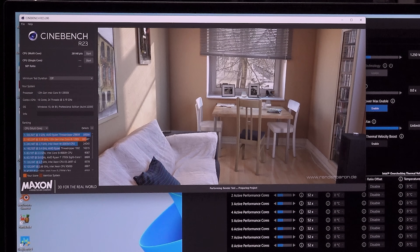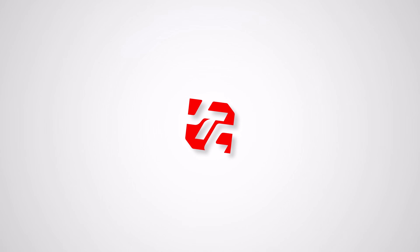Trying to push to 5.2 — and crash. The test didn't even start. That's a clear example: 5.1 all-core fine, 5.2 and it won't even begin. At 1.35V temps were acceptable but not great for an AIO. I'll probably bump voltage from 1.25V and see if I can get 5.2 or higher. After a lot of off-camera testing — run the test, drop voltage, run again, crash, up voltage, up core clock, crash — the repetitive leapfrog process led me to some conclusions.